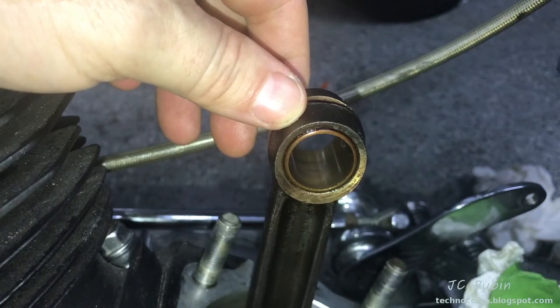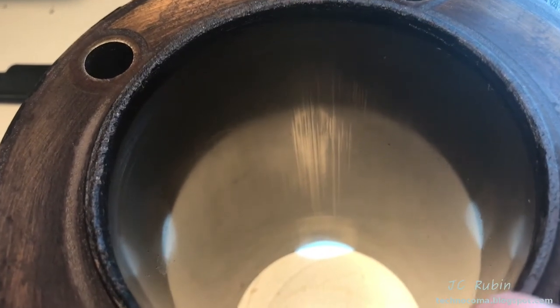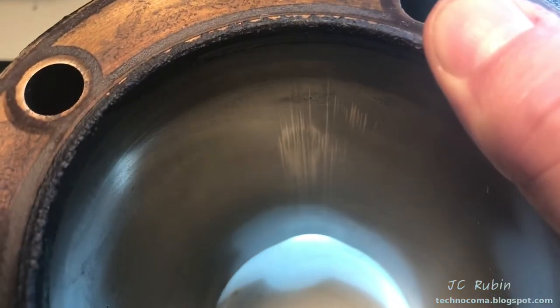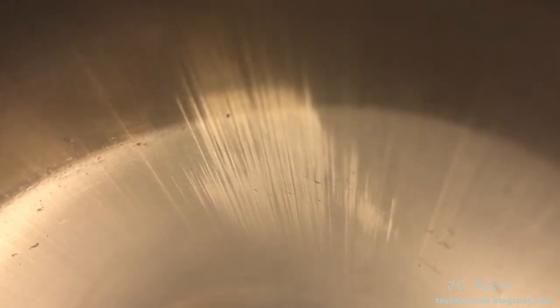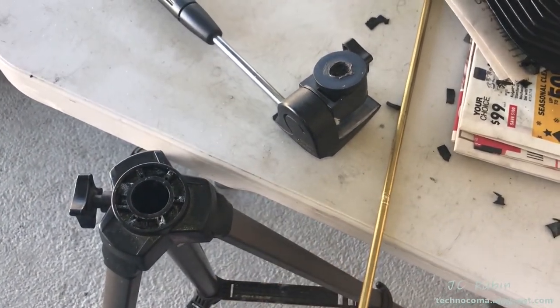I came off the tripod for a moment to look into the cylinder and have a look at the cylinder wall. The wear in here is extremely mild. In the middle of it is some of the original cross-hatching still there — I wonder if it could simply be honed out. I really caught this right at the beginning of what was going on. Even within the middle of the wear you can still see the original texture, and on the other side it almost closes up completely. This is probably something I could just have re-honed and call it a day — I may have dodged a bullet.